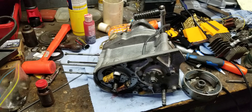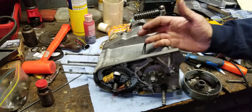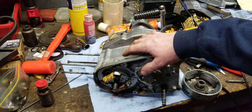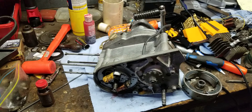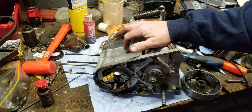You don't want to put stuff together backwards or incorrectly — you don't want to skip things or leave things out, especially thrust washers and that sort of thing. The manual shows you what to look for, including adjusting the clutch — it's all in there. Get the manual; it is gold, it is the bible of this motor. We have the carburetor already cleaned, and we have the cylinder left to fix.